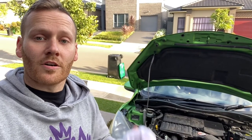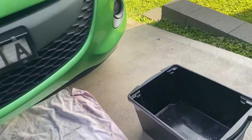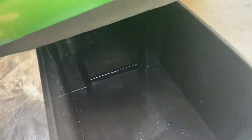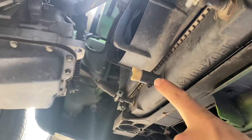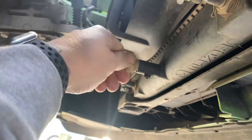To prevent me getting too dirty I'm going to place a towel down for me to lay on. The next thing is to get yourself a nice deep drain tin — the reason for this is if you get something that's too shallow it's going to spurt everywhere, and this is going to help catch all the deflecting coolant. Now the next step is to go underneath the vehicle, remove the under tray if it's fitted, and find the drain point. In this instance ours is quite easy to access, which is just here.